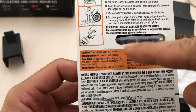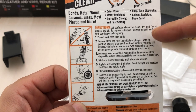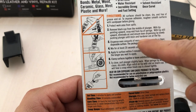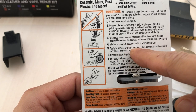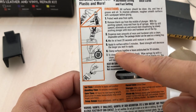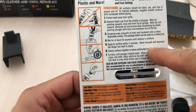The instructions say all surfaces must be clean, dry, and free of grease, and you have to roughen smooth surfaces with sandpaper. Dispense the resin and hardener onto a clean surface, mix for about 20 seconds, and apply within five minutes — after that the bonding strength decreases. It says to clamp it, but there's no easy way to clamp this to the window, so I'm going to use painter's tape.